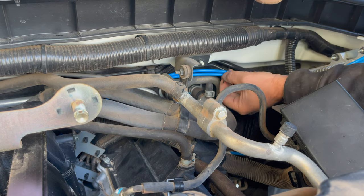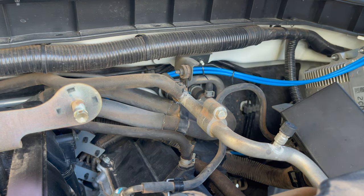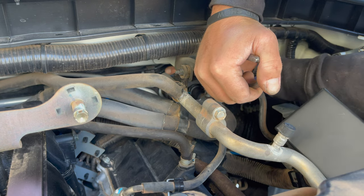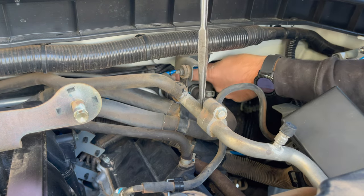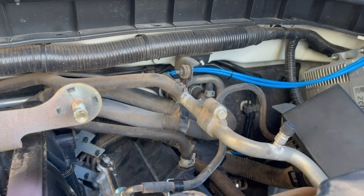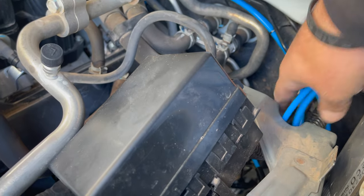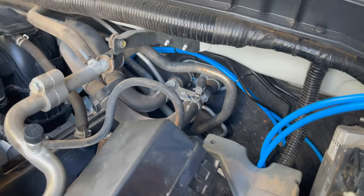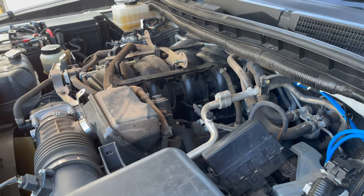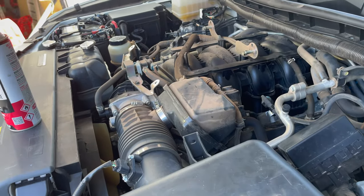This other hose is a little bit more difficult to get — we've got about one more centimetre of room in here, it will be perfect. I think I've found the end — that's in, I reckon. Pipes are all on. Just putting some cable ties on here — a handy tip is you can tie that up wherever you like nice and loosely and use the pliers to run it along to where you need if you can't get your hands there. Both our pipes are going to be fed underneath there — I'll get some conduit, some split tubing, on them. I'll put the engine cover back on, throw some more cable ties on, chuck that fuse box back on.